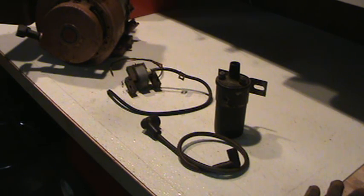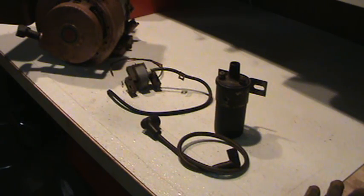Any number of variables come into play. So what people do — they take the automotive type coil, attach it to the points, which open and close at the time that the engine needs to have spark. They hook the other side of the coil up to the battery, and they've got their spark back and their engine running. The only drawback to a battery coil is you've got to have a battery — you have to have a charge to provide for this type of coil. The magneto type creates its own; it's a standalone. It uses the magnets on the flywheel to draw a charge through it and throw that charge to the spark plug.